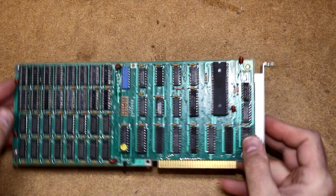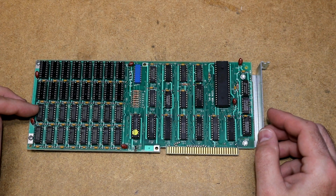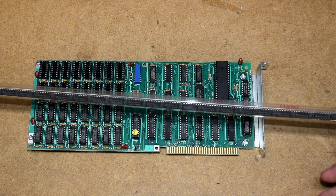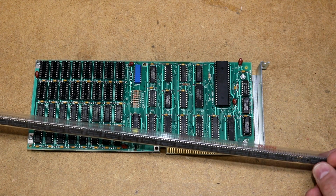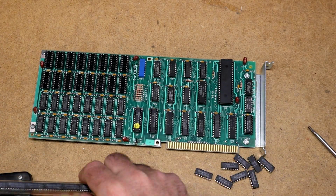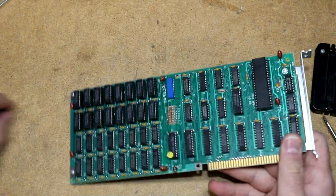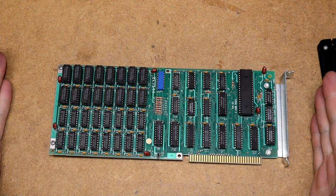These DRAM chips are a part number 804-3665. I looked up, I couldn't really find any 804-3665 DRAM chips, but I did, from a place just across the state, find a whole tube of 4164 120 nanosecond DRAM chips. So what we are going to do is populate this board. Okay, I pulled out one too many. So anyway, we're ready to plug this board into the computer.